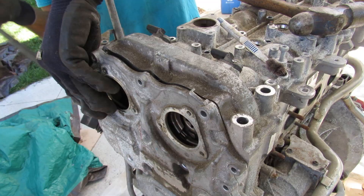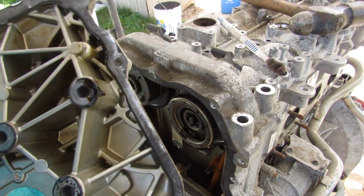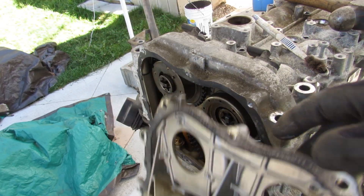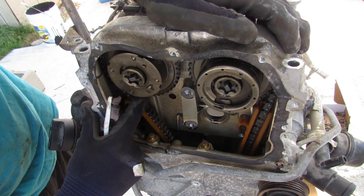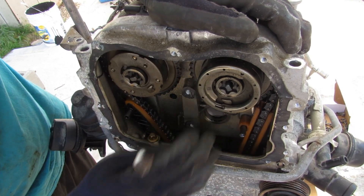Here's what the actuator looks like on this side. Just popping that off — it's just a big piece of aluminum. If this were a Volkswagen or something, they'd probably use plastic and it would leak eventually. Inside here you've got your intake and exhaust cam phasers for the variable valve timing, powered by the timing chain. This side feels nice and tight, but this side feels a little loose — I wonder if there was a timing chain issue.